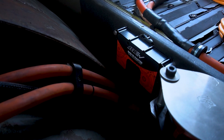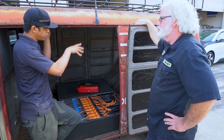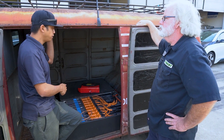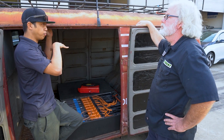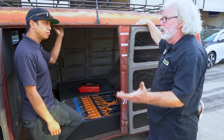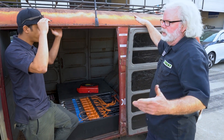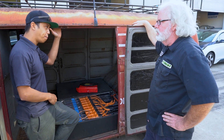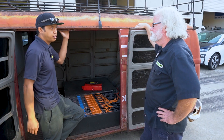The BMS is also interfacing with the J1772 connector, and that does all the relaying of information to the VCU to handle the charging. So when you plug in, the J1772 sends a signal to the BMS, the BMS actually wakes up the VCU to do all the management of the charging. So it'll turn off if there's a high cell voltage — it'll turn off for safety. Or if there's a low cell. It'll prevent you from charging and damaging your modules. That's all automated — once it hits a full charge, it just shuts itself down.